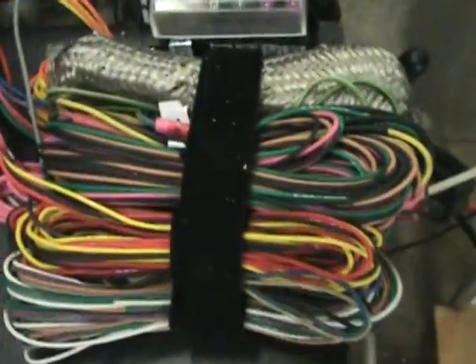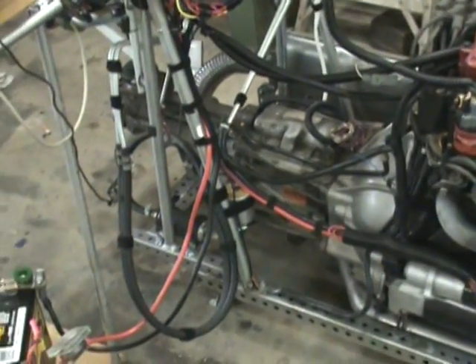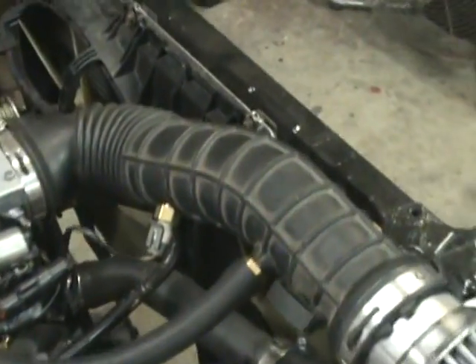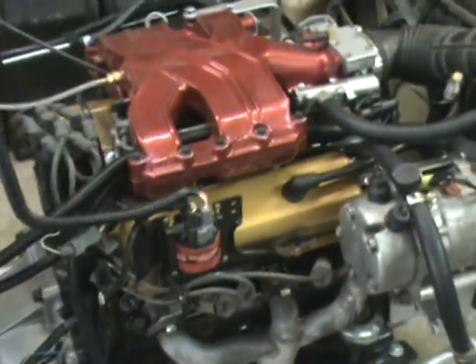Fuses for the MegaSquirt — haven't cut the harness up yet so everything's bundled up. Plenty of wiring coming off the motor. I had the sense to tear the harness out when I pulled this engine from the local junkyard. Really lucked out on the condition — still has hatch marks on the inside of the cylinders, great compression running about 165 across the board. Really happy with the way this engine's running. Maybe I'll swap out a set of Fiero valve covers I may put on, but haven't decided yet.